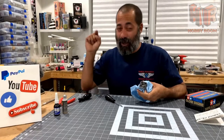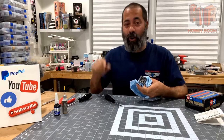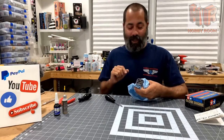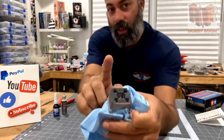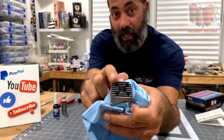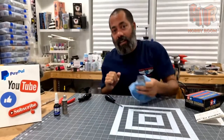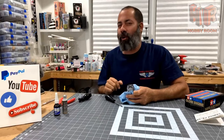All apologies guys, I'm going to start this video with the very end of the video. I answered the question that I didn't get answered during the video, and that is on this very special engine: the side of the head that has the most material — the extra two millimeters of cooling fin — goes on the backplate side of the engine and not on the snoot side. All of that will make sense in the following videos, so stay tuned.